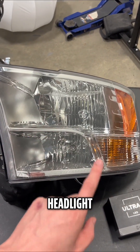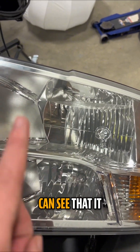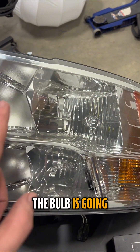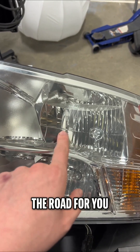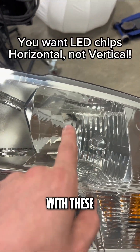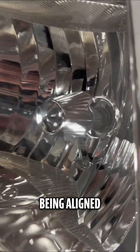If we look at this RAM headlight, this is a reflector and here's your low beam. If you look at how this reflector is designed, you can see that it almost looks like a U that goes around the bulb. The bulb's going to be in the center of that U, and these reflectors are all trying to aim that light forward on the road for you. Well, if that LED bulb is not aligned with these reflectors, your beam pattern is going to look terrible — and it all comes down to the bulb not being aligned right out of the box.